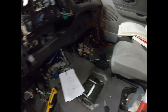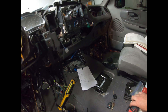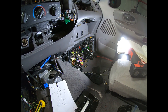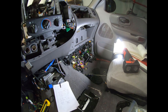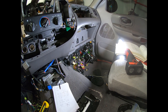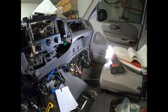I was unsuccessful with my last attempt. I went back and started double-checking all of my wires coming through the passenger firewall bulkhead — I de-pinned about 60 pins over there. Found two pins that were reversed: one was white without a stripe and one was white with a blue stripe, so those two were flipped right next to each other. Fixed that, so we'll give this another shot.